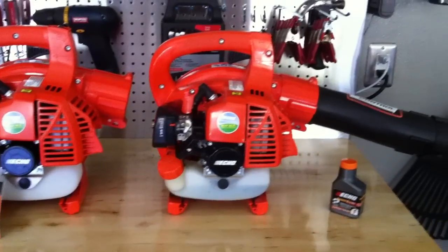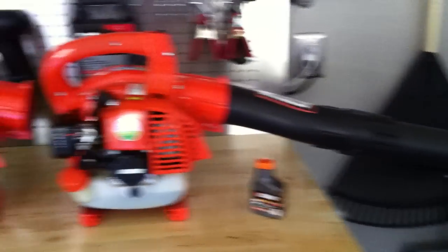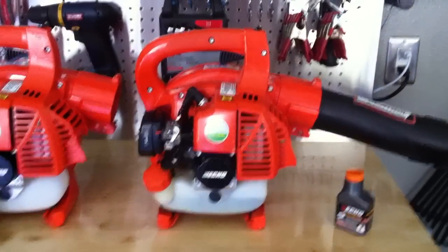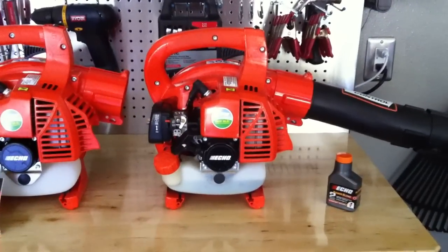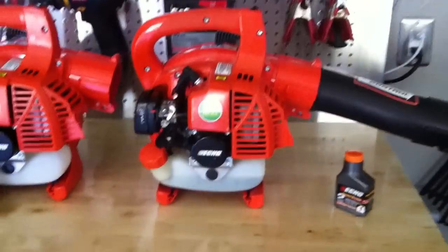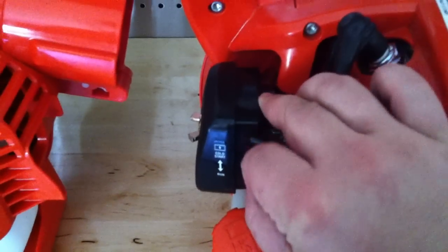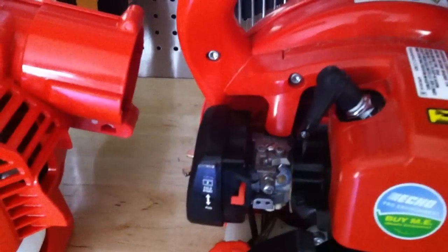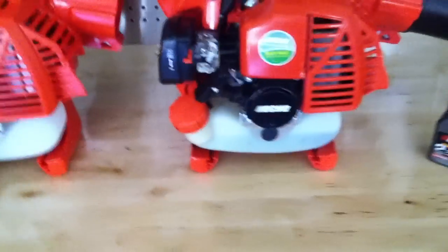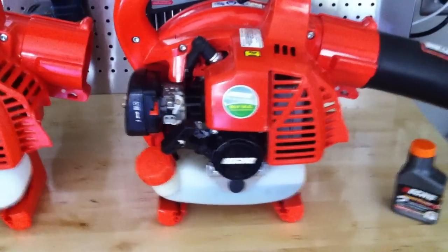I went out and I actually had this blower right here — I've had it for one year. I went out and bought it, used it for the whole season, everything worked great. It sat for about a month or two and I tried to use it again and noticed I had to run it on choke. I'd have to kind of go up and down trying to get it to run with the throttle wide open, and it would basically only run about half power on full choke. It was a problem that just kept lasting and lasting.